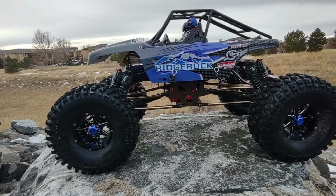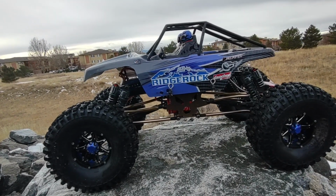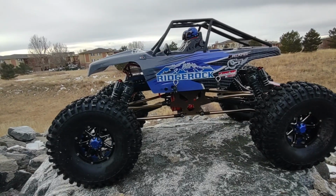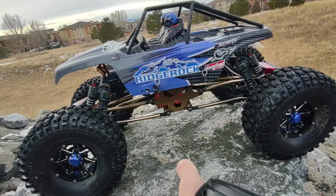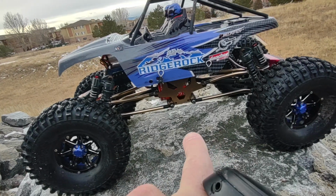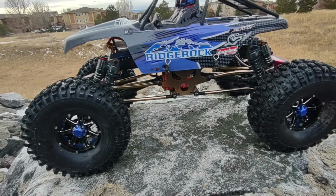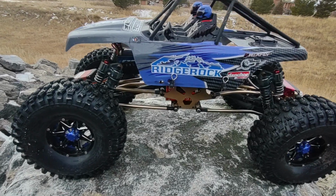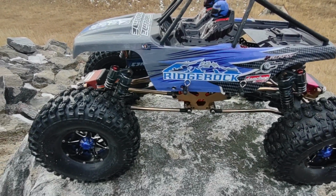If they get lifted up forward and the belly droops down further, it kind of catches on things a lot more. And if I angle the links up and bring the belly up as well, you kind of end up shortening the wheelbase in between, and you get more clearance, sure, under the belly, but you end up sacrificing in other areas with the geometry. So it's taken a while to get it to this point where it's at, and I'm happy with it, so I'm not going to tinker with it any further.